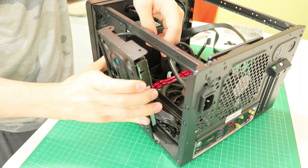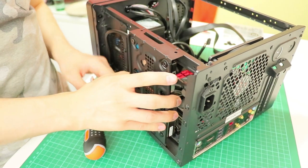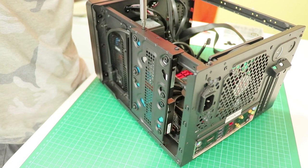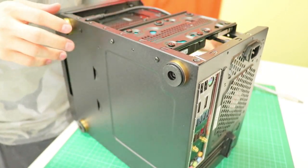Installing the side drive mounting bracket presents the 14mm 2.5-inch drive top slot incompatibility, so I swapped the drive positions around, which just about worked with the CPU power connector on the motherboard. After replacing the screws to the side drive mounting bracket, which serves as an excellent cross brace to the chassis, we needed to take a quick look at the power supply unit position.